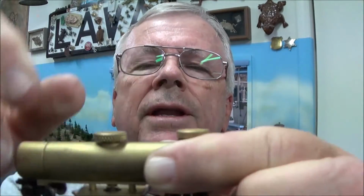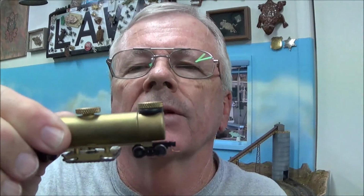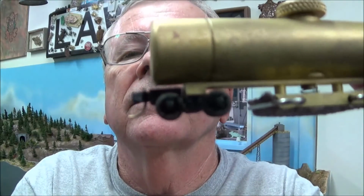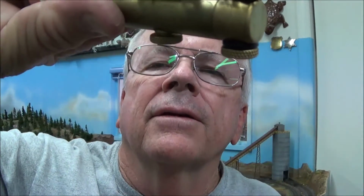But once you get done with the car, you close the needle valve and you close this O-ring, the filler valve, and no more alcohol is coming out of that car. You can see that it is now not dripping. I can turn the car upside down. There's nothing coming out of the vent hole. Okay, so that will keep the alcohol in the car.